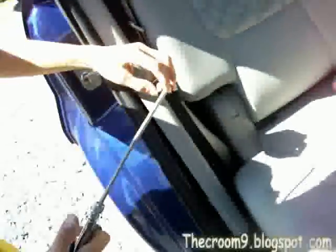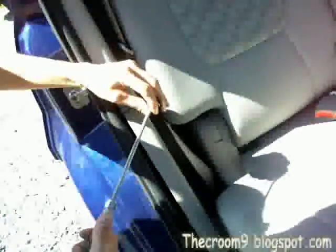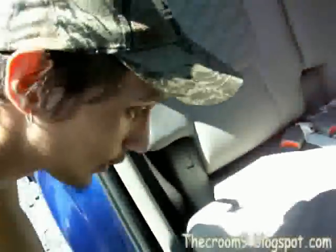You can see once stuff gets in there, it's awful hard for it to go through that little crimp. But we're just going to blow some air backwards through the tube. And if there was a block in it, you'd hear something clear, and you'd begin to hear air up on the top where the sunroof is. You can't see the two drain holes on the top. You can see the fronts though.